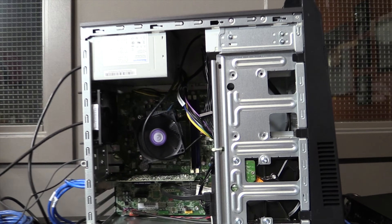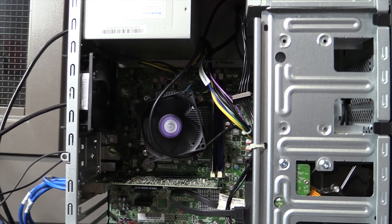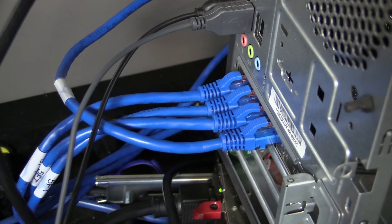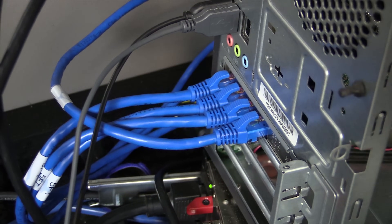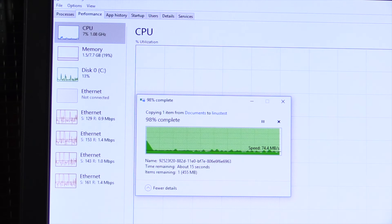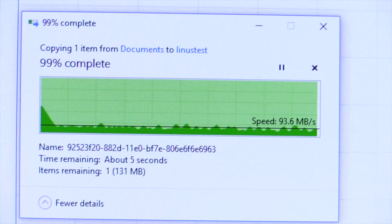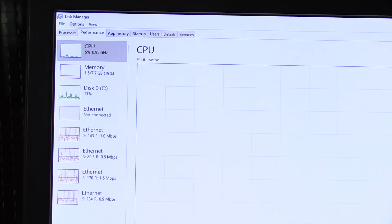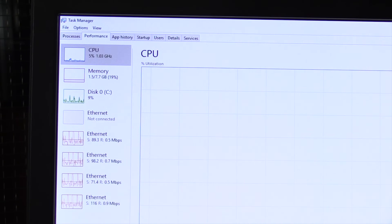What the heck? Time to bring out the big guns. Johnny ran home and got his custom Z170 ASRock board with an Intel Core i5 Skylake chip, and a random Lenovo pre-built with a Core i3. We put his NICs into those — a couple of Intel i340-T4s that are a bit more expensive but still quite affordable — and voilà! Transfer speeds in excess of one gigabit. Not particularly impressive still, and frequently dipping below gigabit, but importantly we saw activity on all four interfaces.